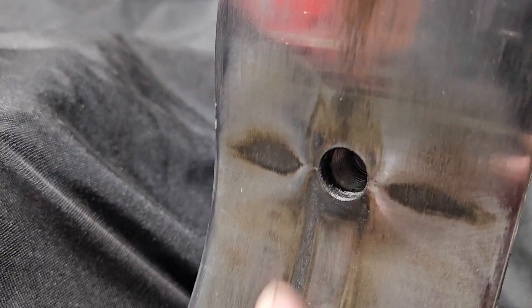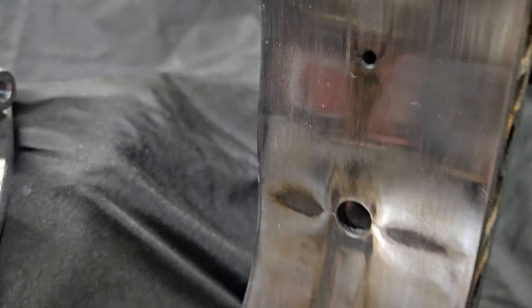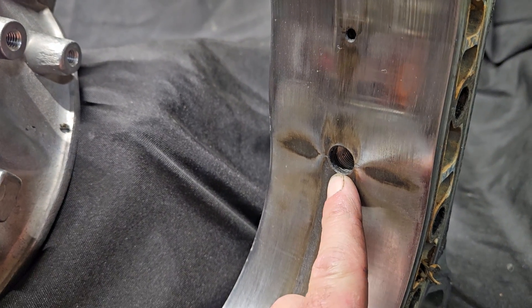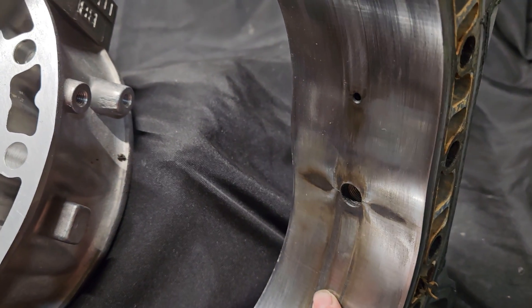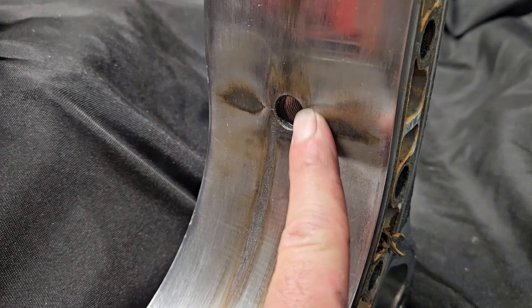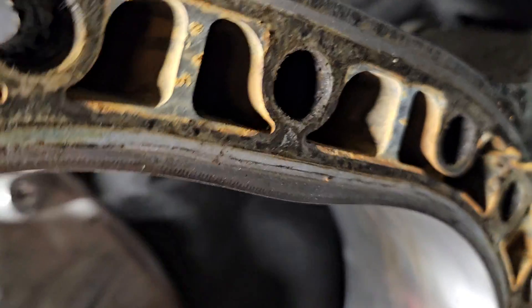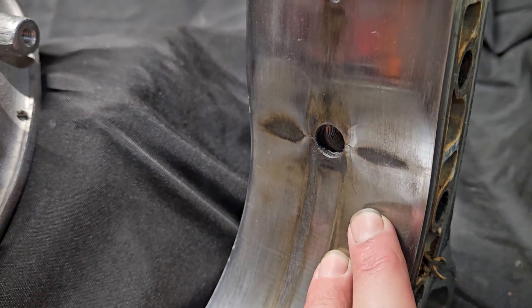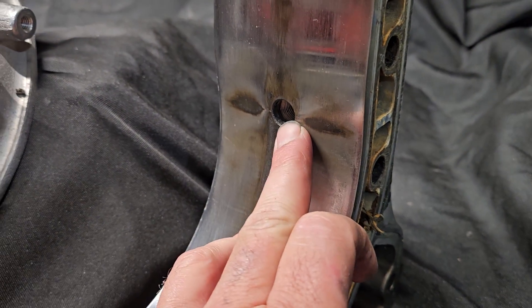You can see there are actually cracks in the chrome, and you've got the heat marks and shrinkage I'm talking about, all built up around the spark plug pocket - which would be the lower, which is the lead - and you've got your trail up here, the smaller one. Generally, you don't need to do water jacket modification; you can see this was not ported or modified. But if you are having a repetitive issue where you're cracking around your rotor housing's spark plug area, then that is a sign of excessive heat buildup.